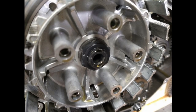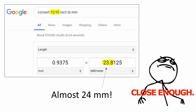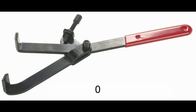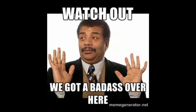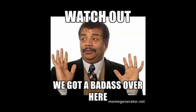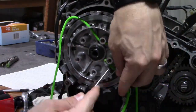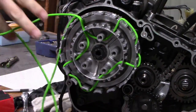With the staking defeated, we now have the challenge of loosening a 24mm nut that is on a rotating shaft. I don't actually have a metric socket that large, so I just used a 15/16ths instead, which worked really well. The Honda recommended method for holding the shaft is to use the Honda designed clutch holder tool number 07724-005002. I didn't want to buy that tool or a generic equivalent, so I tried a couple of DIY solutions. Eventually I figured out that I could anti-rotate the inner disc by threading paracord between it and the outer disc. An impact wrench didn't actually help here because the paracord was too springy — just a regular socket and wrench did the trick.